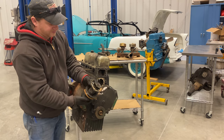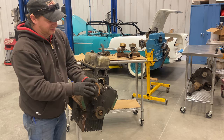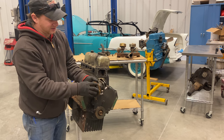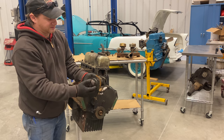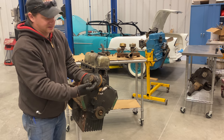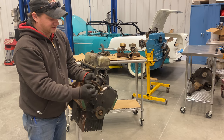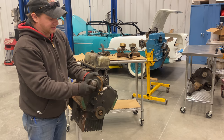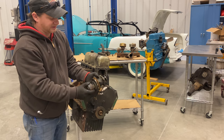Here's our first item: the water pump. It does still move, but you can see there's a chunk missing out of the pulley. That's quite common on these cars — it's actually a lot more common on some of the later cars; they made the pulleys even cheaper. In fact, they would just rivet two pieces of sheet metal together to create a pulley. This one feels all right — if it was greased, it might feel really good.